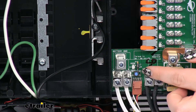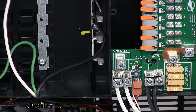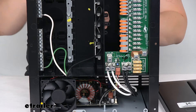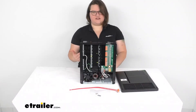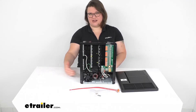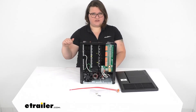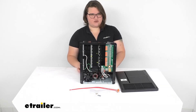Right underneath that is this little blue button — that's going to be the override or manual adjustment for our Battery Wizard. That's kind of one of the unique things from Progressive Dynamics: this is also going to charge your batteries while you're using them, adjusting the power output from the unit to make sure it charges those batteries effectively. That's why it's important to have that switch for lithium versus lead acid, because they require different kinds of power outputs — lithium typically requires a bit more power. This will help maintain a charge level for the batteries so they don't get stratified, keeping them working nicely for a long time.